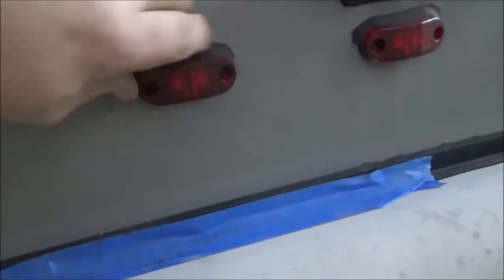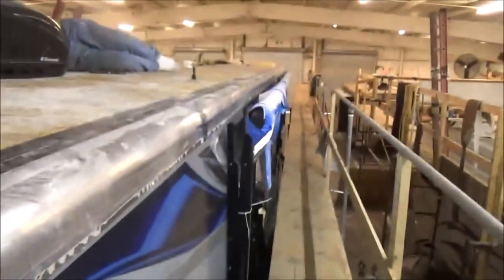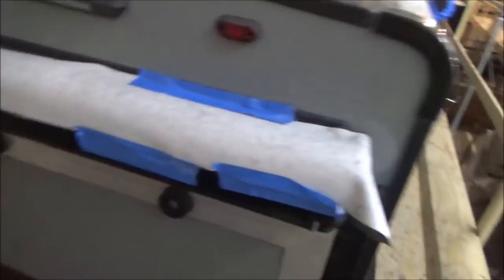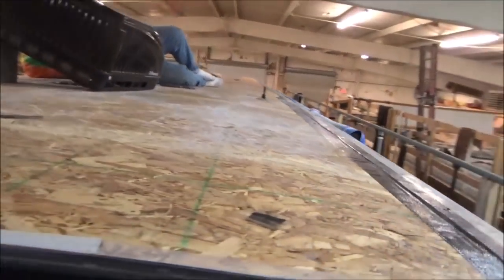I'm going to make sure all this is tight right here. I'm going to go around all your lights, around all that stuff. You want to make sure everything is sealed - if water hits it, there's a way it can get in, it's got to be sealed. Water will find its way in even down inside here - everywhere you can think of. All we're doing here is just protecting the awning on the back so we don't get anything on it. So far we'll be back with more great adventures at RV Roof Installs.